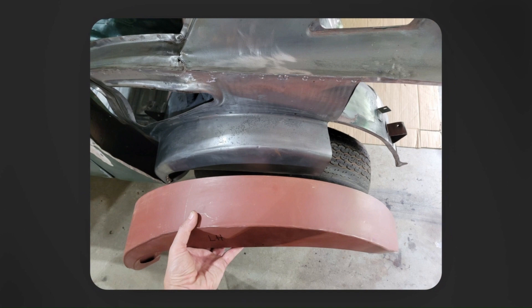As you might have guessed based on what I've done so far, I do have outer wheel arch patch panels for the car for both sides. At this point I intend to save as much of the original as possible beyond what I've already cut off, and cut and work in the patch panels around the good original metal. The very back portion of the outer wheel arches and most of the lips where they are spot-welded to the rear wings will have to be replaced. This may prove a tedious and somewhat delicate process, but it doesn't really scare me.